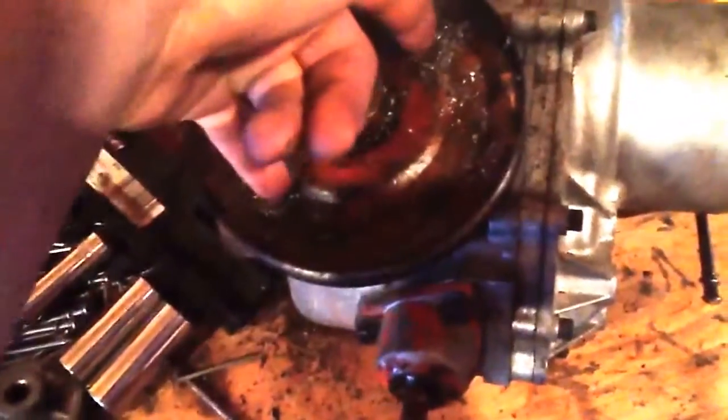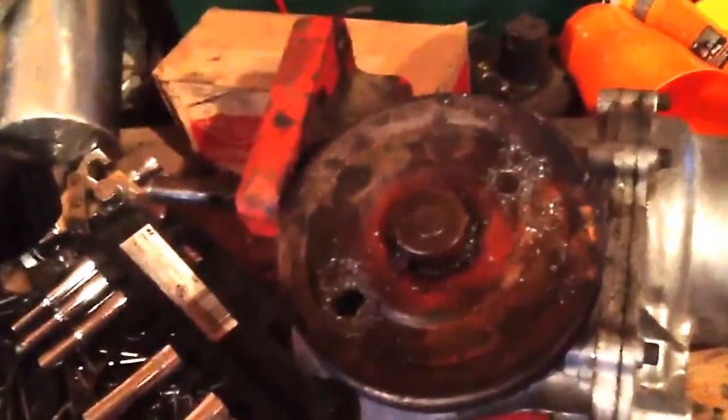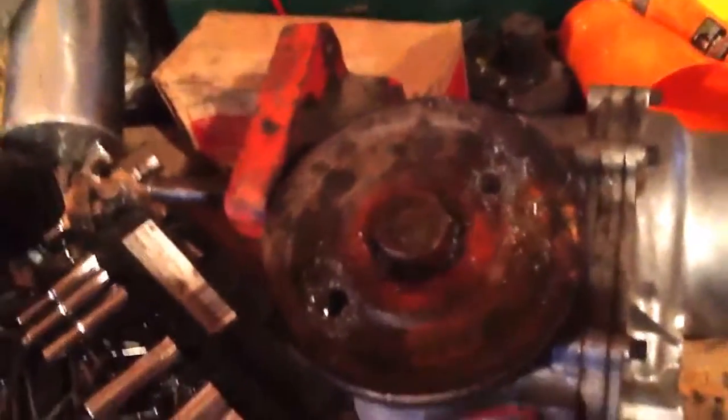It's Thursday, and I'm going to try to have this thing race ready by Sunday, because I want to try to get it down to the race on Sunday. But all I got to do is clean up the front axle, put the red in, and get the pulley off the trans. I drilled these holes in it because I had my puller on it, which goes down through the holes. But I couldn't get it off because the puller's too big right around here. So I'm going to soak it for a day or two, and then I'm going to try to heat it up and pull it off.